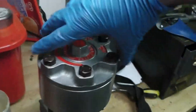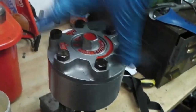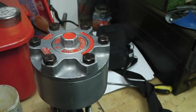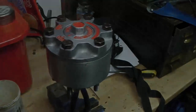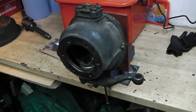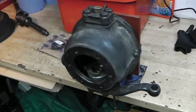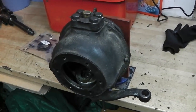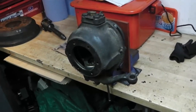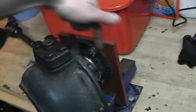I've just popped the hub together - no clicking when I rotate it in the free position. It operates and locks into the fixed position quite satisfactorily. I've got a set of new gaskets and I just need to find some felt washers, and that's ready to fit. I'm really trying to press on with this now - some of the steam rallies and so on are fast approaching, the new season will soon be upon us, and I really want to get this done. It's dragged on all winter. Last night I went out and caught the last half hour of daylight, and eventually working by lamplight, to strip the offside swivel and brake unit in about an hour and fifteen, which was pretty good going. All the bolts around here were a right tussle - they're conveniently just a bit longer than the nuts so they rust.